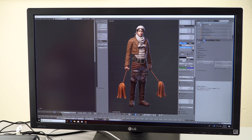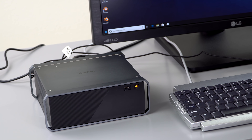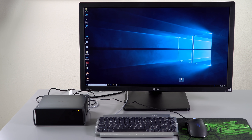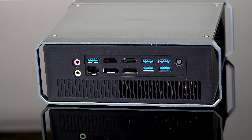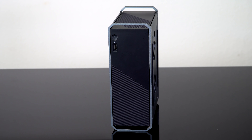It is still a desktop — you'll need to plug in your own mouse and keyboard, or use Bluetooth ones. This does have Intel Wi-Fi and Bluetooth on board, and obviously you connect the monitor of your choice. We're using an LG 4K monitor with it, and it had no problems driving that 4K display — pretty impressive. There are a lot of ports on this, true of Intel's own reference design as well. There are two full-size DisplayPort 1.3 outputs, HDMI 2.0 on board, and a USB-C/Thunderbolt 3 jack on the front which could drive another monitor.